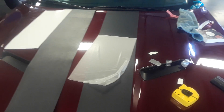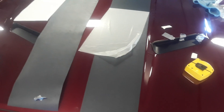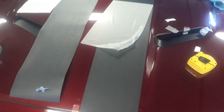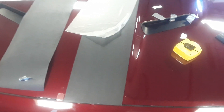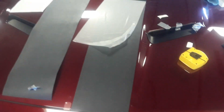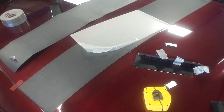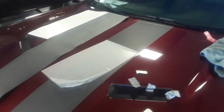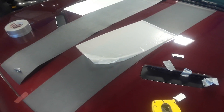This is kind of a generic video — if you can install this, you can install any of our kits. Just take your time, don't be in a hurry, get it where you want it, tape it on the corners, do the hinge method. If you start wrinkling, pull it up and redo it again, because it takes a little while before it's fully set up. I usually tell customers after 72 hours it's fully set up, and that's correct. But if you're in hotter climates, it's usually faster than that.